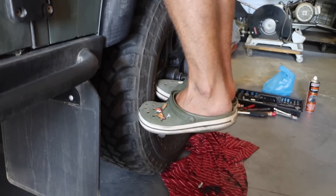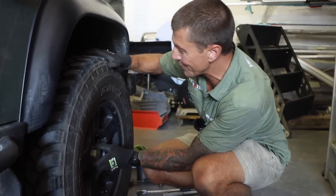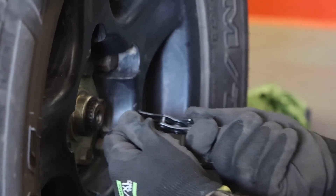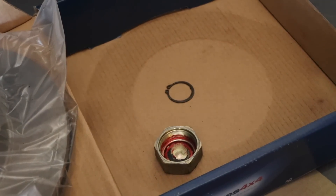Sometimes they're a little bit tight. You guys remember we've got a bad habit of losing these things and having them fall off — we found one on the road recently. I don't know the exact torque setting but I've been putting a little bit extra on there because I don't want to keep having to replace them. There is a difference on the Land Rover Defender between the front discs and the rear. I've gone for the stock standard — I did consider vented and slotted sports brakes but from everything I heard they don't last as long, and we've never had an issue with braking. These discs are almost seven years old; they've had a good life. I've got a little box here to put all my parts in because it's so easy to lose a nut or bolt in the dirt.